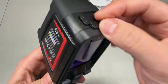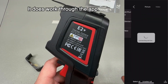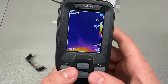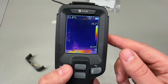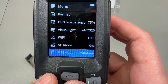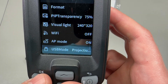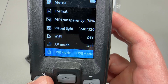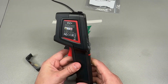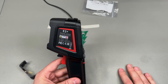If you want to download the captured images, you connect via the USB Type-C port to your computer and the camera appears as an external drive. It might also be possible to do it over Wi-Fi, though I haven't checked. It's important to note that you have to set the USB mode option under the menu to USB mode — the other option is projection, which provides a video feed as a webcam. Also important: I could only get this to work under a Windows PC; my Mac did not detect this as a storage device.